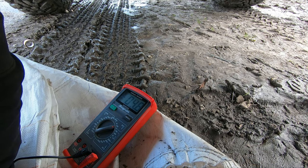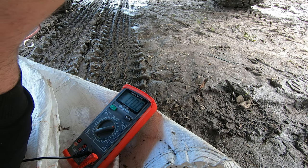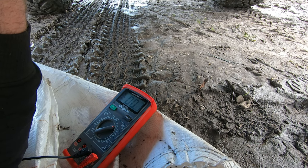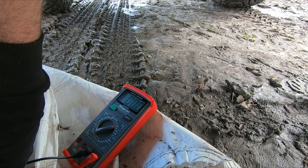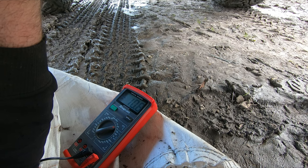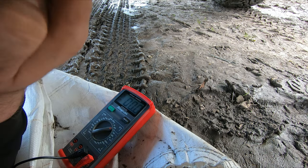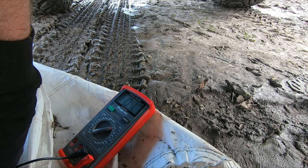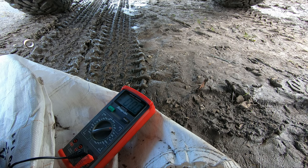We've got some voltage there. That's our five volt reference wire, which is the yellow with the red tracer. Now we're trying to get battery power — and there it is. It's reading about 11.3 volts; the battery is a little bit flat, so that's why it's low. So we've got earth, battery power, and a five volt reference. The wiring from the cluster to here and from the battery is all good.